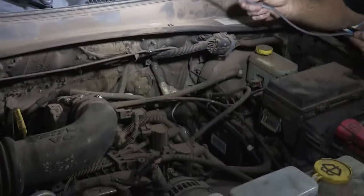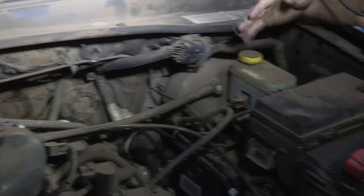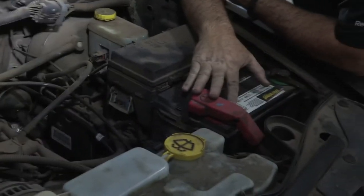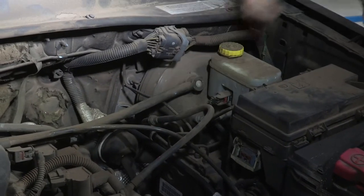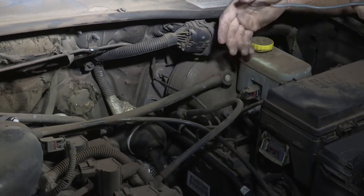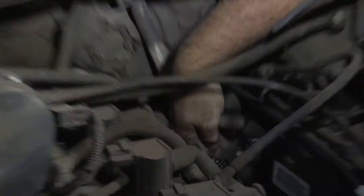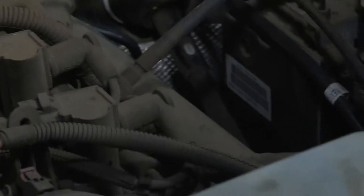We're ready to take our fish wire and run it straight down. Before we do that, I'll talk about a couple of things up here. Here's our battery where we need to connect. Here's our brake reservoir where all the brake lines come up to. Brake lines are a good route because the vehicle manufacturer has already determined this is the best path underneath the vehicle. One thing you want to avoid as you go down is this steering arm — it does move, so don't touch it or wrap around it.